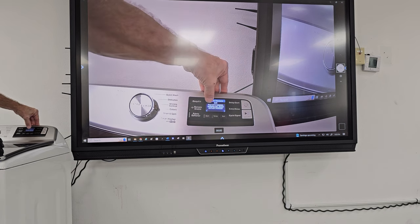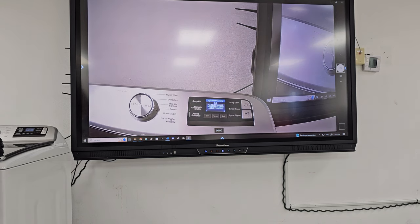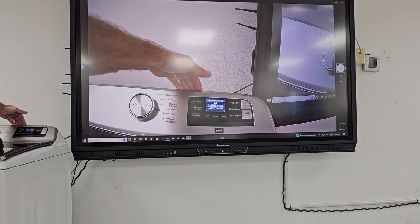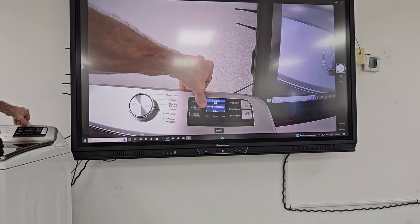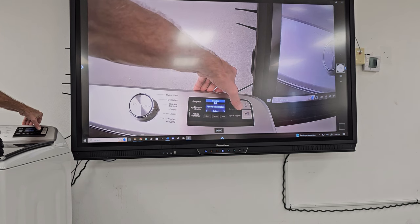And we go here, part number, revision, serial. So the part number right there is the part number for the main control board. If you needed a control board, I don't think that looks like a right part number, but W111-00000 would be that. And that is the part number for the board. So what do I do to get out? Deep fill. Deep fill. So I'm back up here, and I'm back into system information. I go one more time, and now I'm at factory diagnostics. I'm going to skip that one for a minute, and we're going to go to the next one.